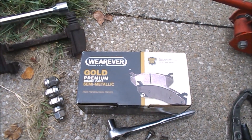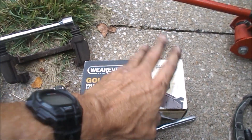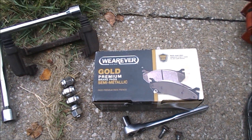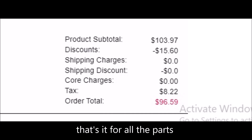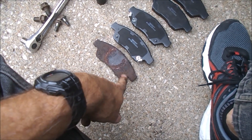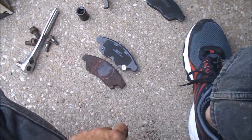Let's open the box and get the new ones out. This is what I picked up — gold premium semi-metallics. I just hope they don't squeak. Ultra-quiet braking, and they were on a massive sale, which is why going through Advance Auto Parts beat Amazon. This is the one that came off this side of the car — it's got the little wear indicator noise creator on this side, so I'm going to use this one on this side. These are symmetric, so it doesn't matter there.